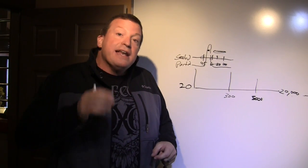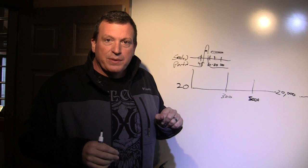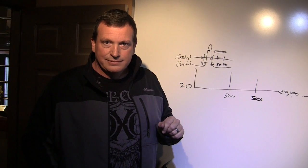So now that you understand the frequencies, let's jump back to the boxes. Now every subwoofer that you purchase is going to have a book in it that will tell you the optimum airspace, okay? For a 12-inch or 10-inch, it's always roughly 1.5 cubic foot behind the speaker box.